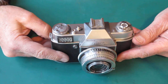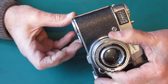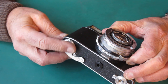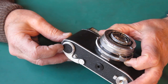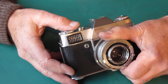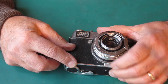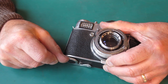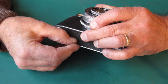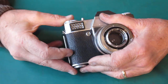Looking for clues — see this lever? Look at that wobble. What that means is that the cam on the base of the film advance shaft is loose on the shaft. When you press down on the shutter release, the film release shaft is pressed down, but the lever on the end doesn't press down far enough to click to the next level on that cam, because the cam is loose. That's certainly a problem, though possibly not the only one.